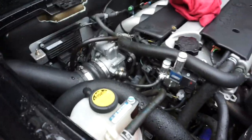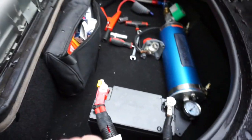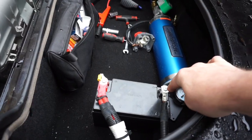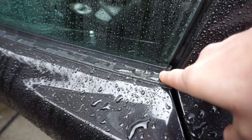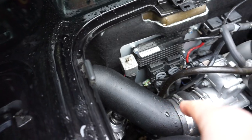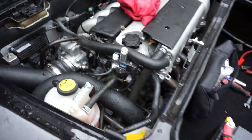But what I'm gonna do next, soon, probably next video, is get a new bigger battery. I'm gonna do another ground from here into the chassis. I'm gonna wire it down where it was on that one. And then I'm also going to do a ground from the engine, the 2ZZ, down onto the firewall as well, and maybe that'll help it.